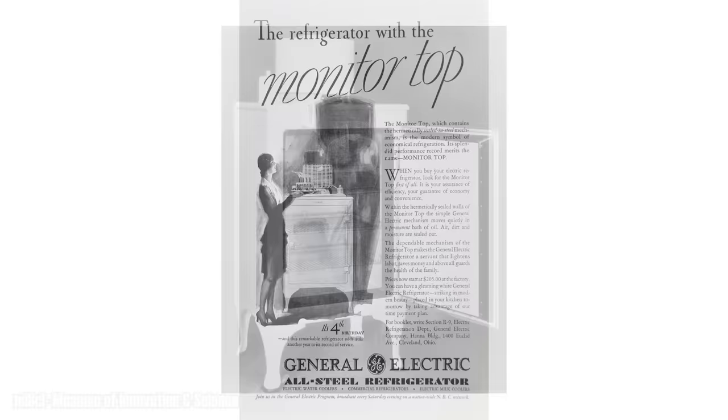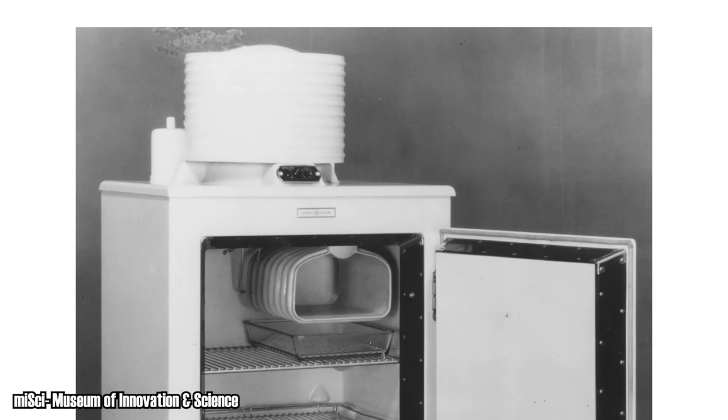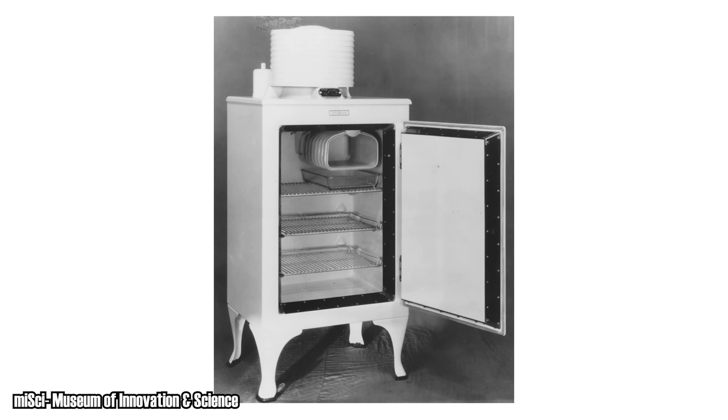Well, yes! And the earliest refrigerators were literally just that. The classic monitor top fridges from General Electric were effectively just an old-fashioned icebox with a small refrigeration system quite literally bolted on top. Inside the box was the evaporator, which absorbed heat energy and got cold, and up top was the compressor and condenser, the latter of which rejected the previously absorbed heat to the outside air, getting warm in the process. This is pretty much the simplest fridge design possible — just a box with a thing inside the box that gets cold when the compressor runs. Use a thermostat to switch the compressor on and off based on the temperature inside the box, and congratulations, you just built a fridge!